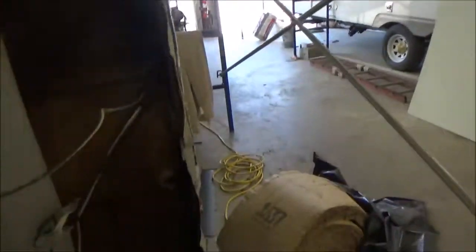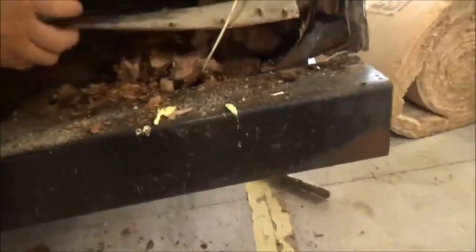I don't want to start tearing all that apart on the other side - this is the vinyl, there's no reason to take it all apart. We're gonna reframe all this, stitch it all back together. The bigger problem is we have got a rotted floor - severely rotted. This is the shower up inside here on the other side - that's the shower pan. We've also got some tank lines here, so we're not gonna start doing it from the inside. We're gonna go from the underside, go on the inside, take out the shower and the tub, and patch it back in that way. There's probably a leak in there.